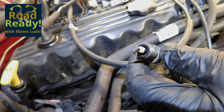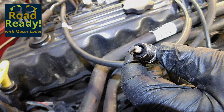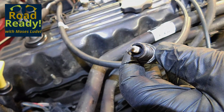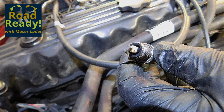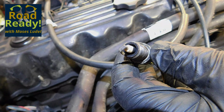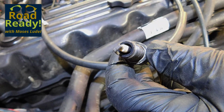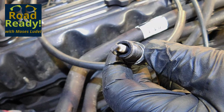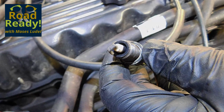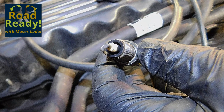This one spark plug shows some carbon buildup. We know that we're getting adequate compression per cylinder, and you can see that the plug was firing. This buildup of carbon, however, is something to watch. And recall, this is number 5 cylinder again, where we have carbon buildup in the upper cylinder. This encourages us to use a scan tool, and we will, to see what the fuel trim is in the PCM management of air fuel ratios.